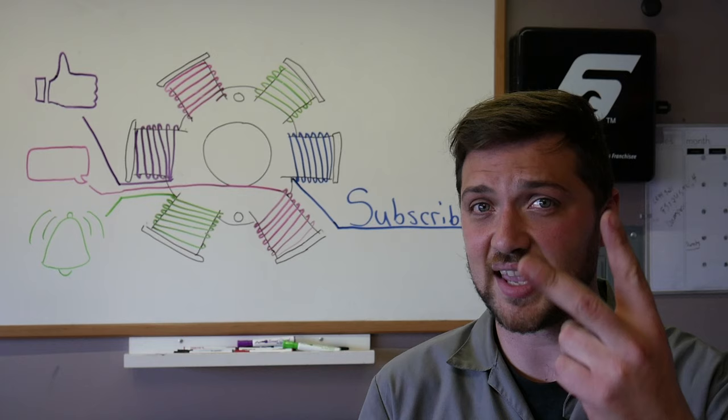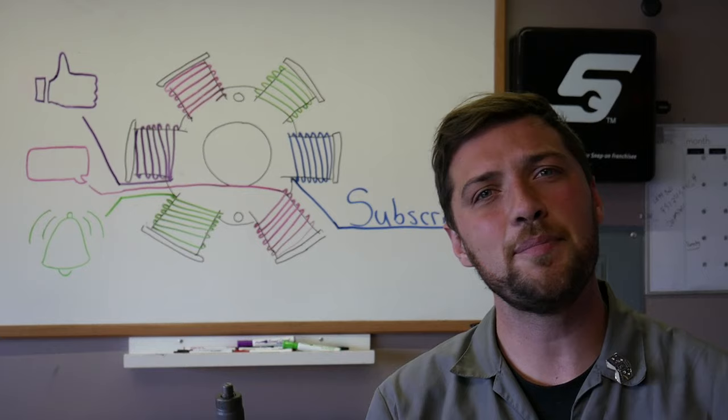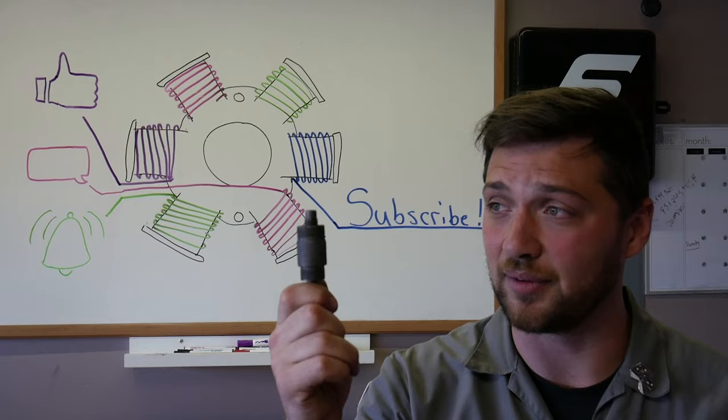The second specialty tool you're gonna need to do this job is a flywheel puller. Now, I know you may be hesitant to buy such a specific single-purpose tool, but keep in mind, you don't need to purchase the most expensive one. In fact, I'm going to be replacing the stator in this video using the cheapest flywheel puller I found on Amazon. I think I paid right around $7 for this thing.